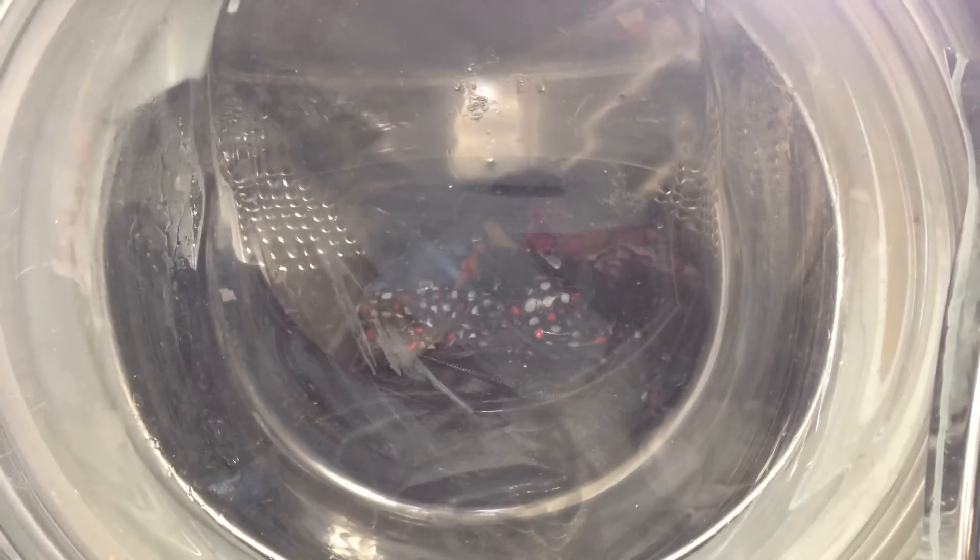Normally you've got twice the load that's in here, but it's as if the motor hasn't got enough power. So we're going to set it back off, check all the wiring, and measure the motor resistance and see what we can find.